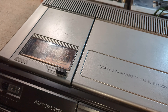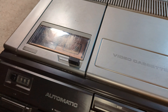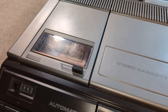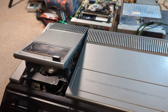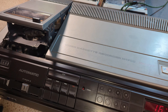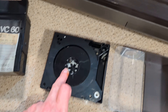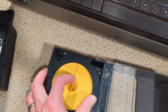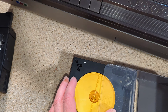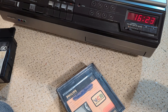We're going to have to do some pretty serious work on this — probably belts, maybe a servo issue with the head servo. This is a 1700, and I'm pretty sure these two cassettes are 1700 and that one's 1500. What I'll do is label them so I know. Let's take the top off and just see how they've done the AV out.